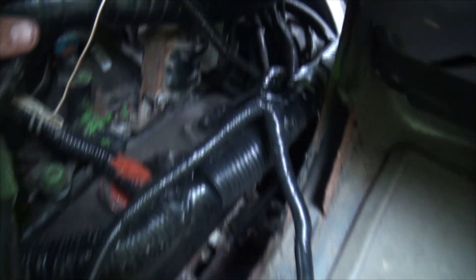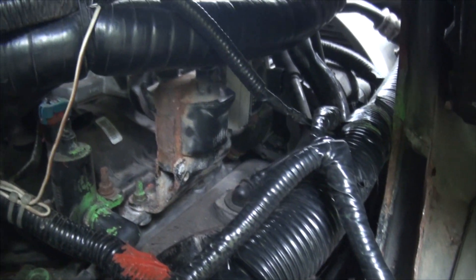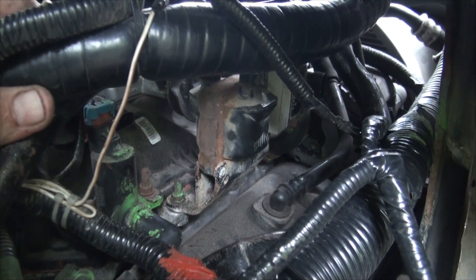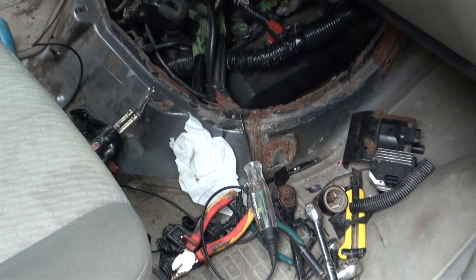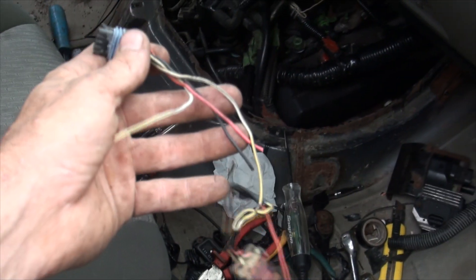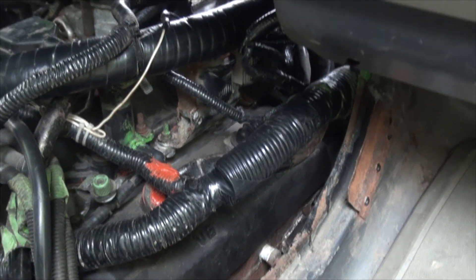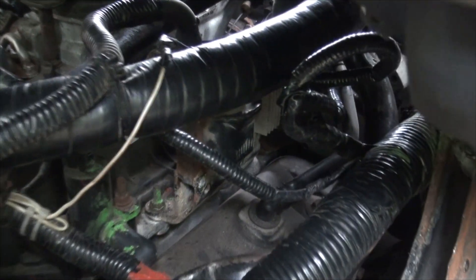I don't think it's going to fire up, because I'm pretty sure when I moved that plug it killed the coil or the ICM — or maybe it killed the ICM, which killed the coil. I think that's what was happening before because both of them were going. But then I went to a 2004 GMC Sierra that I have — that ugly black truck — cut off the wires from it, installed them on here, plugged her in, and she fired right up. She's been running for about an hour since then.